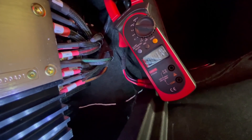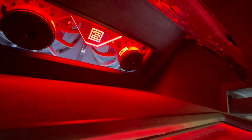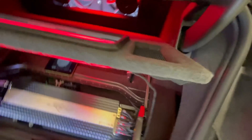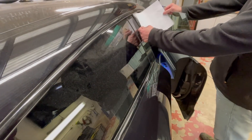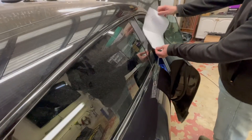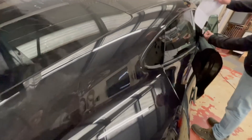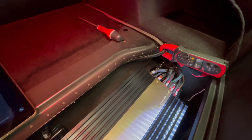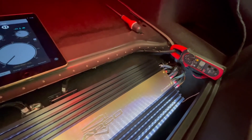And that's pretty loud. At 20 hertz, probably 70 percent of excursion on the subs, pulling 18 amps — and it's the trim panel that's flexing now, that's what you hear. It's moving proper air with the full door open. That's IB for you — it's just sensitive. 18–20 amps on 13 volts — you do the counting on how much power it takes to make those subs move.